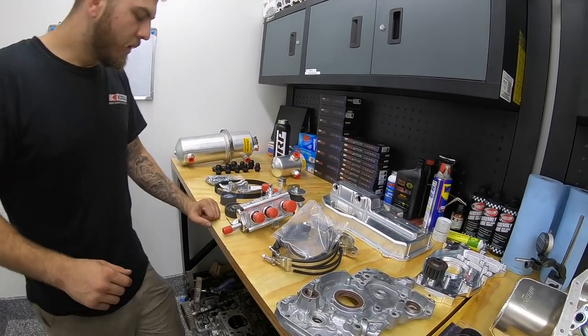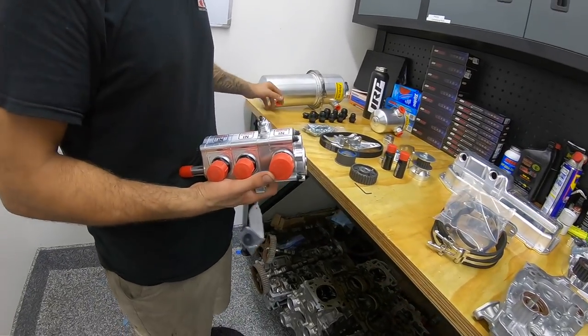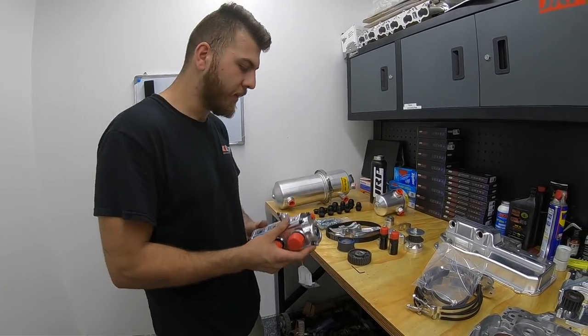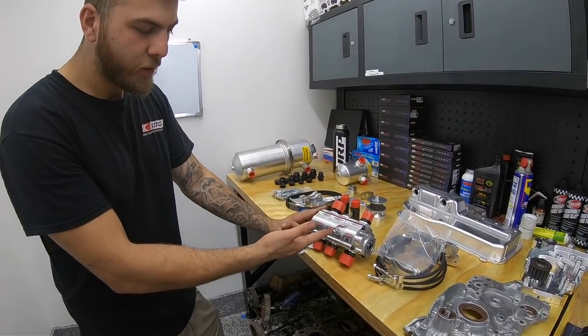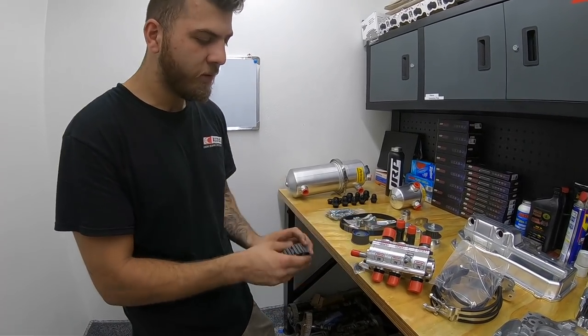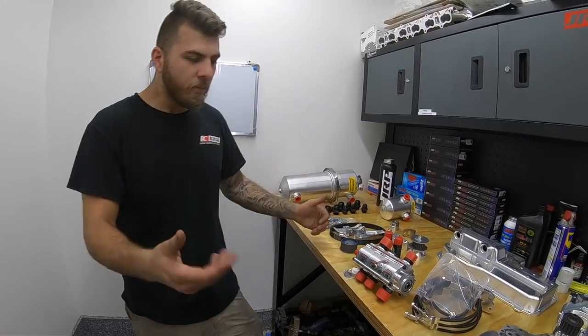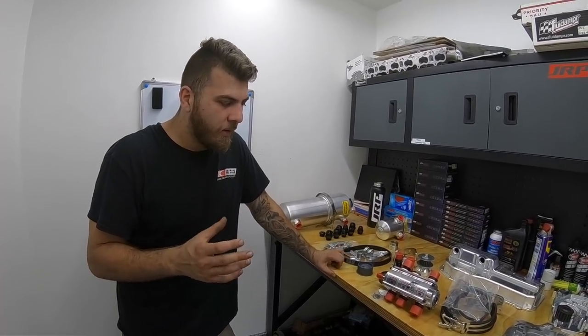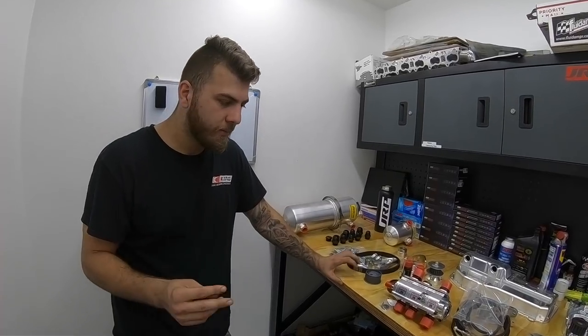The 4G63 doesn't have that issue, so we're solely scavenging from the bottom of the sump. There's a pressure port that picks up from the bottom of the tank and always feeds high-pressure, non-frothed oil to the engine. You can also adjust your oil pressure — give it as much as you want. If needed, you can change rotor sizing or gearing. This relates back to that hydrodynamic wedge — looser bearing clearances create a cooler, thicker wedge for more protection against flexing parts.